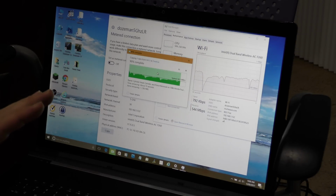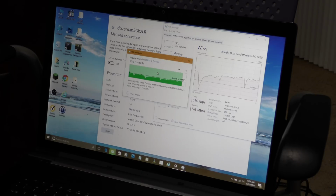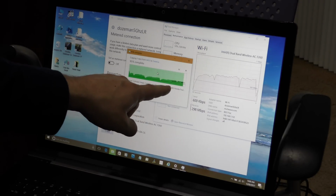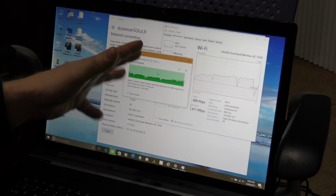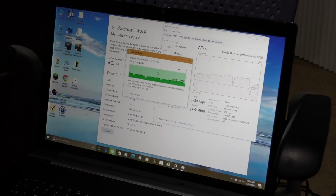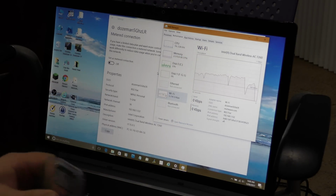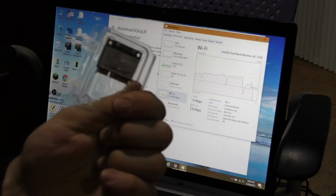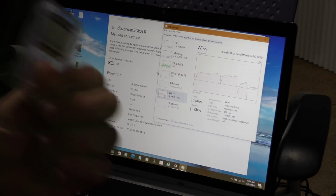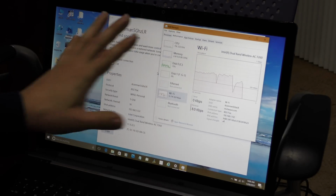And just to be clear here, before we wrap up the video, this is not going to help your internet. Unless you've got internet that is faster than this connection speed here, which is, it's dropping back down, which is right around 50 to 60 megabytes. You're not going to see any advantage between switching between this and the new card I just put in. This old card here handled the internet just fine because the internet connection is still significantly slower than what this card can handle. And of course, compared to this card, it is even ridiculously more slower.